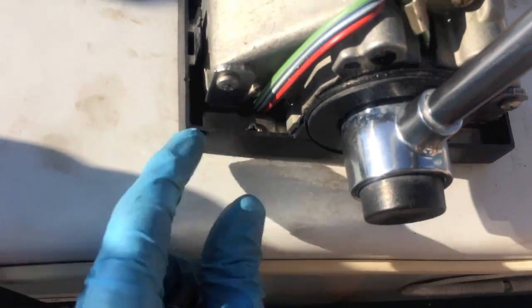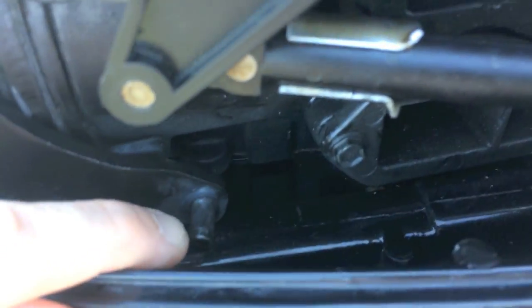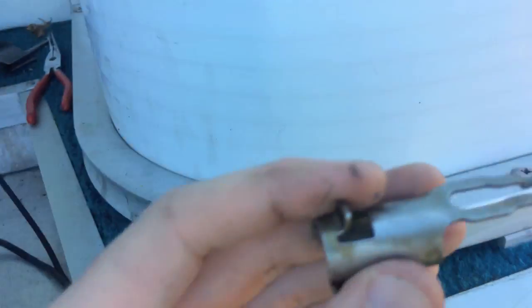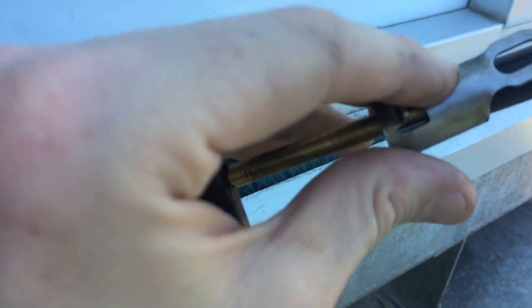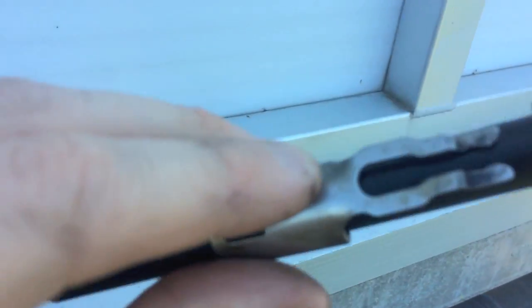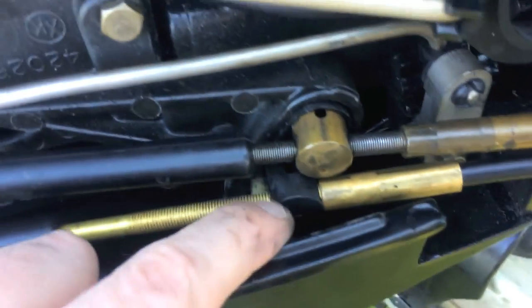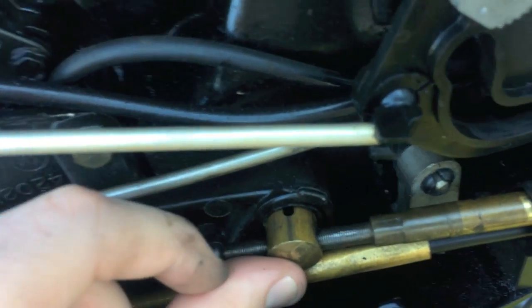For this little plastic piece, make sure it goes into that little plastic groove. Back down at the engine, we are going to position it back and put the tip hole on that little tab there. Then this little adjustable barrel we will also insert after we adjust it. For the cotter pin — an easy way to put it back on, as opposed to pushing it, is to just slowly feed it down and insert this part and clip it into place. Cotter pin mount is back on and secure.